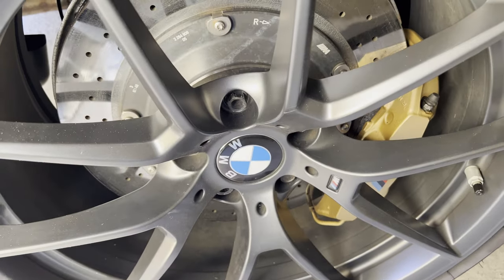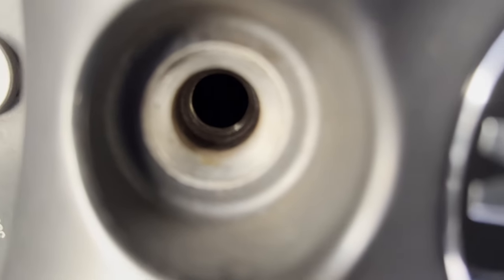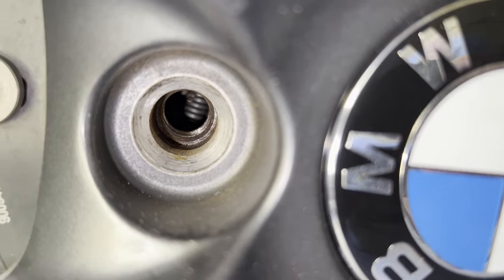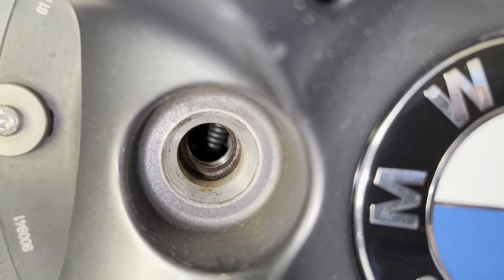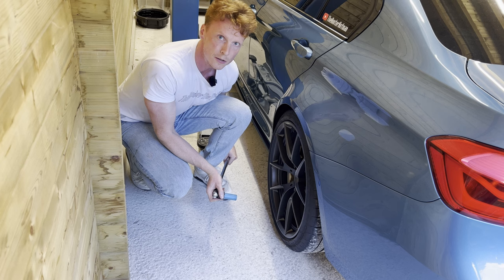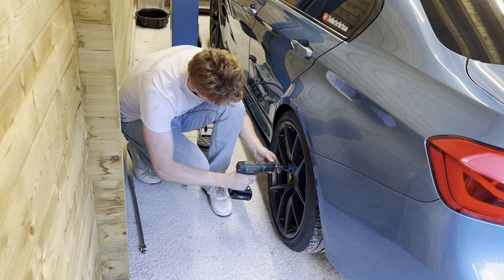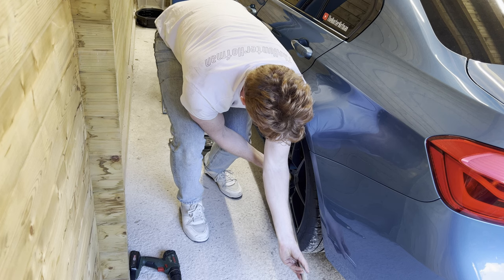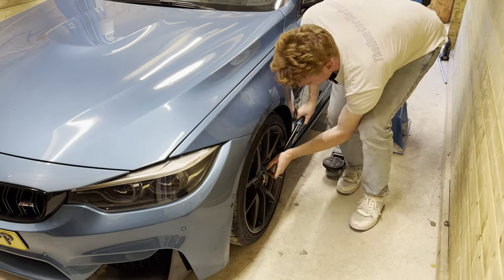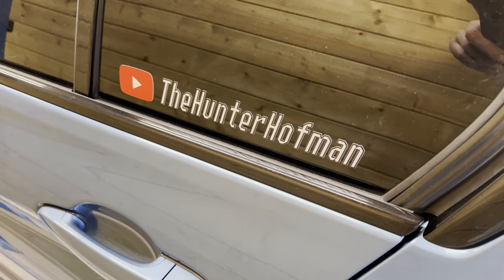Should be quite something if that was the culprit — let's do this. As you can see, this is the difference between the stock wheel bolts and the longer wheel bolts — I believe it's only 10 or 12 millimeters, but as we men know, that makes all the difference. I'm currently in the process of replacing the longer wheel bolts for the shorter ones. You can see over there the spring where supposedly the wheel bolt is touching against, making that sound. We're going to undo the longer wheel bolts, remove them one by one, install the standard wheel bolts, tighten them, and repeat for all four wheels, torquing them all to spec.